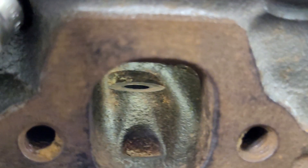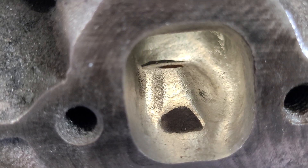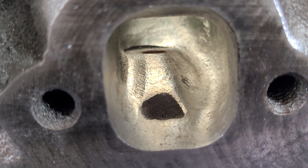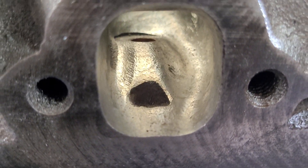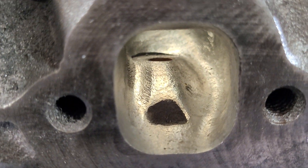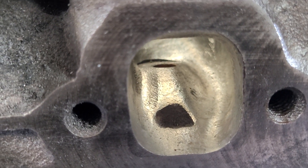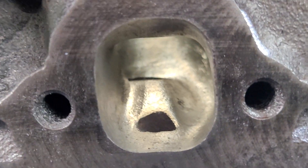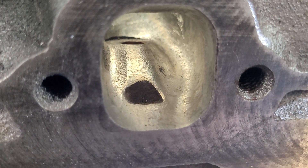The stocker exhaust port is really half E7 and half GT40 P — right between them both. These are not drilled for the EGR; those are blind holes, so if you really wanted to you could raise this port quite a bit. I'm probably going to keep stock exhaust outlet sizes — I know what to do to get some decent flow out of these.